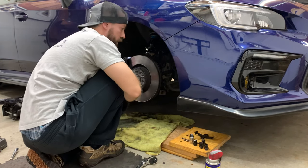One of the things you want to try to do is not touch the actual rotor surface. I am going to wipe everything down with IPA when I'm done, but it's good practice to keep your hands and dirt away from the rotor as much as possible. As you can see on the car, it's pretty straightforward — these are floating rotors, they don't get bolted down. The calipers actually keep them in place. That's how you install rotors — very, very simple. Brakes are actually extremely easy to do. If you've never done it before, it can be intimidating, but I promise you it's literally two bolts and a couple of pins to take the pads out. The rotors literally just slide right off. Don't be intimidated by this — it's a really fun install, and I suggest you save yourself a couple hundred bucks and do this yourself.